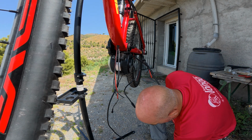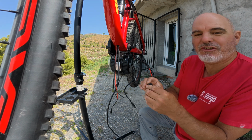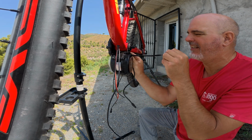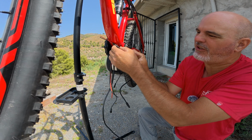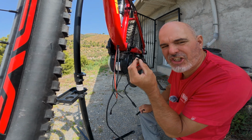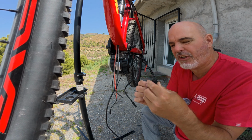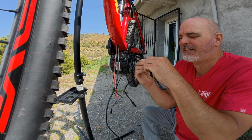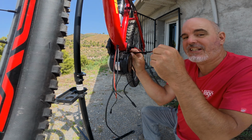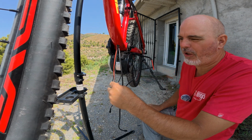Right, now before I do anything else, because the last thing I want to do is get all these soldered up together and realise that I forgot to put this grommet on, which is going to go up into the hole here. I'm going to thread this grommet on first, get that right back out of the way, so that's ready to go back up into the hole afterwards. Plus, I'm going to double heat shrink these after I've soldered them, but also then when that's done, I'm going to put a piece of heat shrink over those as well, over the two wires there, so we don't forget that. I'll slot that on as well, because that'd be classic Mac if I forgot to put that on. Okay, so I'm going to strip these wires off the end here and then try and prepare for soldering.